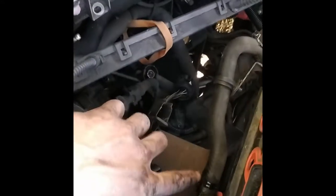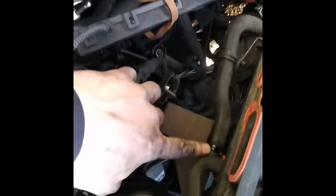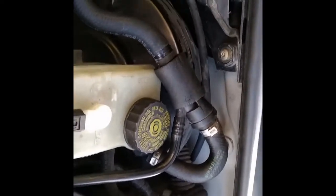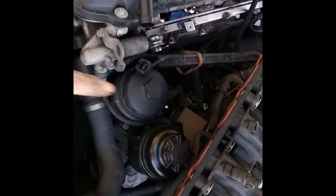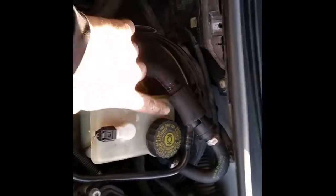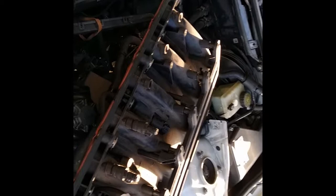I took the banding off and began stripping out the clamps. I realized this is another difference from the M54 engine because you will find all these things here — this kind of vacuum arrangement. On the M54 engine it is below the intake manifold, so once you take the manifold out you need to cut the clamps and replace them. I realized after cutting that clamp — my bad — that I could have just cut a different one and taken everything apart. This is a particular feature of the M52TU engine which is really cool.